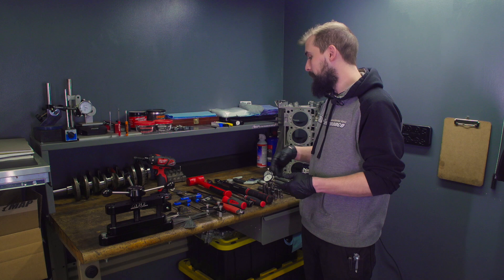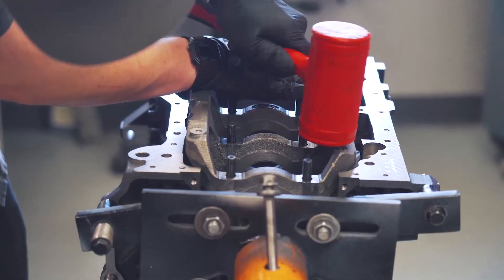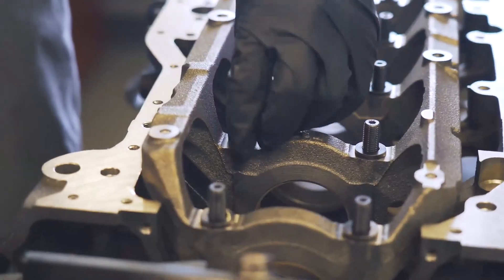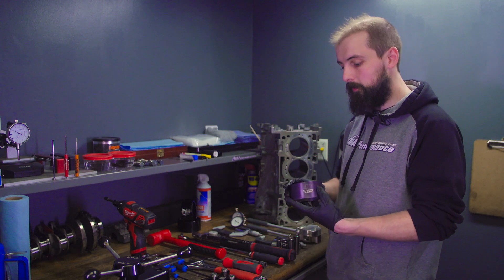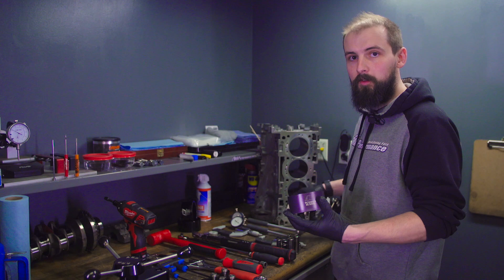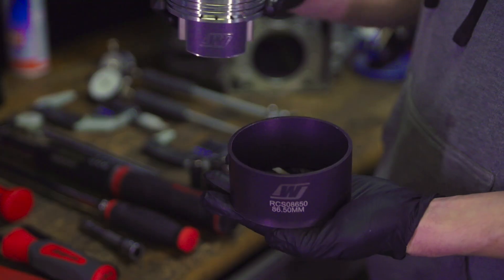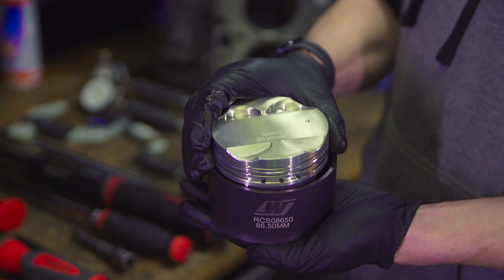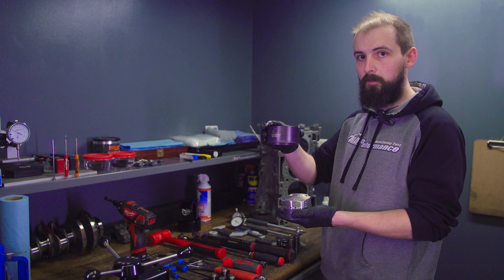Once everything is ready and the pistons are ready to install, I use a rubber hammer for installing them and seating the rod caps and seating the crank girdle. And then we have our Wiseco piston installer — we use different sizes based off of the size of piston that goes into the engine, and these make it so that when we put the piston in and install it into the bore, it's clean and seamless.